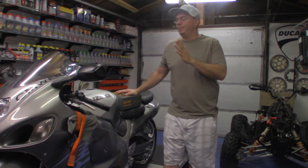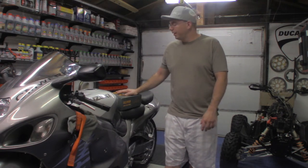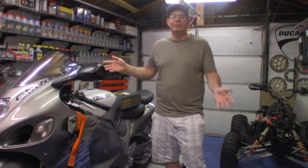We're going to change the air filter out. Basically, if you own a bike or you're working on a bike and you've had it a couple years, and you ask the customer if they've ever replaced their air filter and they say no, it's probably time. A lot of people don't realize that here in Illinois we have large temperature changes throughout the season, so bikes sweat. When you have engines with oil and aluminum radiators with antifreeze, during the winter they get cold, and as they warm up your engine will actually sweat — that'll run through your whole engine and create rust and all kinds of problems. Same thing with your air box — you can get moisture inside, and most air filters are paper filters.